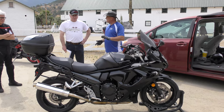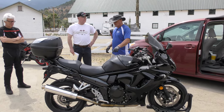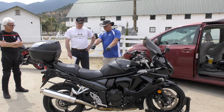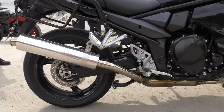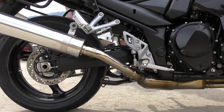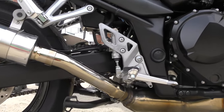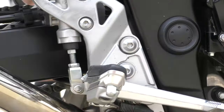We've already experimented on one bike to see if it was worthwhile, and we know it's an excellent idea. Your problem is that your rear axle is very much in line with your swing arm pivot. We need that rear axle below the swing arm — the GSXR shock is longer and gives you the correct geometry in the corner, so you actually turn better.